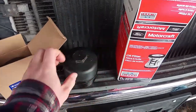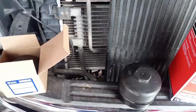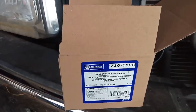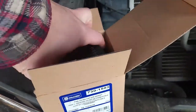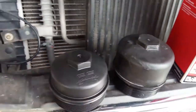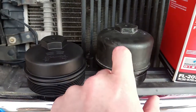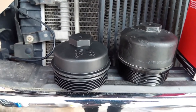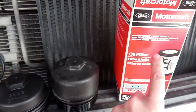These filters are shorter than the filters that go in these caps. I just bought this filter cap from Napa — it's supposed to be a fuel filter cap, but it also is an oil filter cap. If you go ahead and put a factory oil filter in this cap, it's gonna be too short. It's not gonna properly close up all the passages where it's supposed to. You need to have this filter cap if you're gonna use this kind of filter.